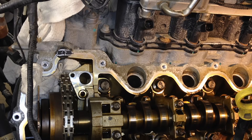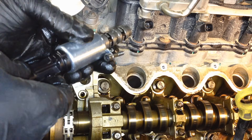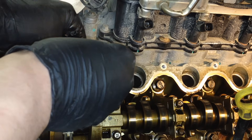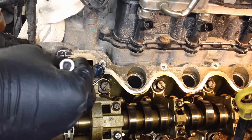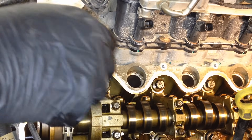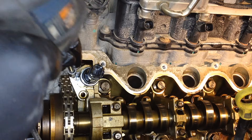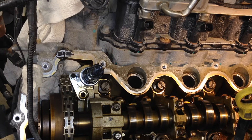The screen has cracked and lost screen material inside, so it's a good idea to look down in the bore with a flashlight all the way to the bottom. There are two slots in the side for the oil feed — check those and make sure there's no fine debris or pieces of screen before you install your new solenoid. The new solenoid comes already oiled internally and ready to go with the bolt included. Line it up — there are no seals, the bore is so precise it seals itself — and get the fine-thread screw started by hand. We don't want to cross-thread anything. Tighten it up hand-tight; there's no need for torquing these.